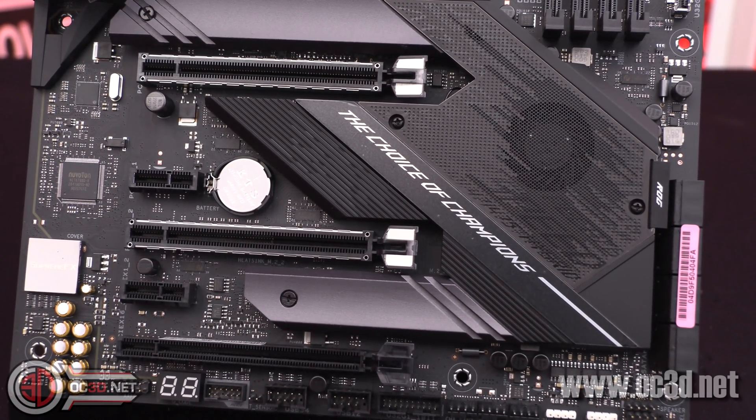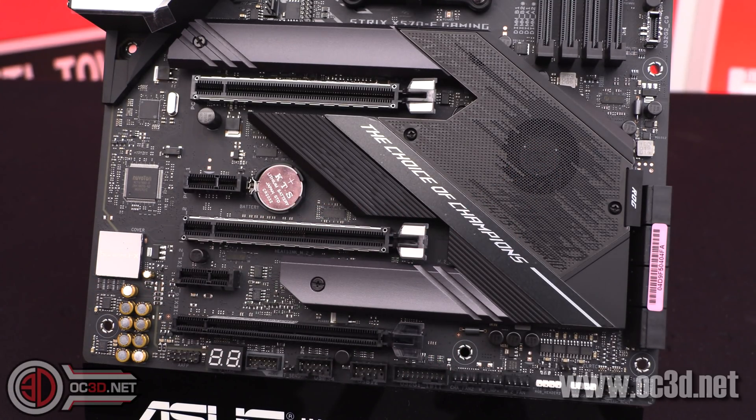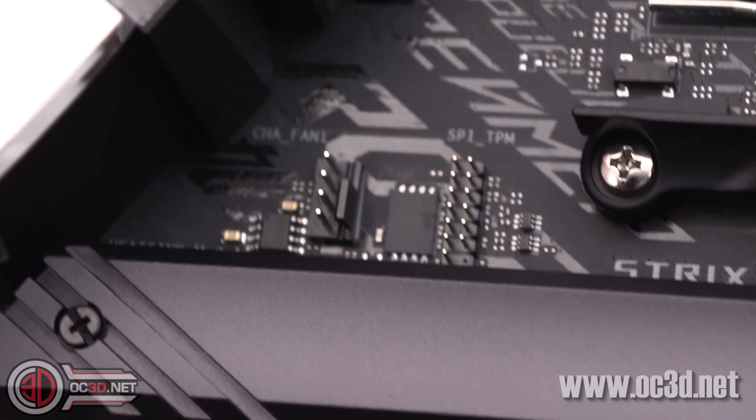You can see a chipset fan. That's something to do with the fact it's PCIe Express 4 — things may be getting warmer, and there's a lot more hardware on the board to make PCIe 4 work properly with all the drives, graphics card lanes, and switches. You're probably going to see across all brands that X570 boards compared to last gen might seem a little more expensive — that's why, because there's just a lot more hardware on the board.